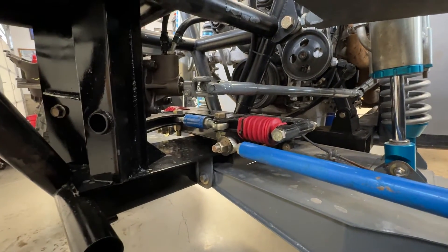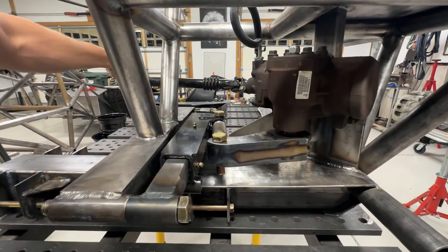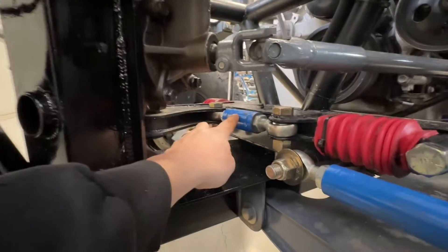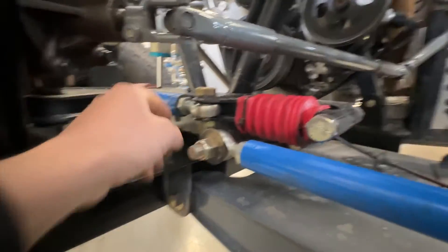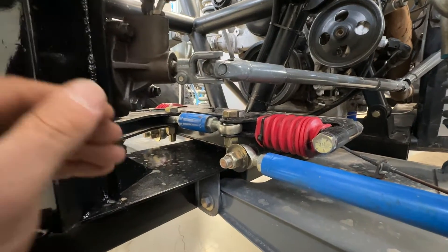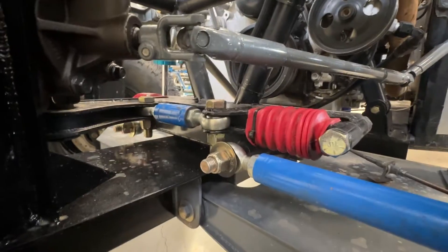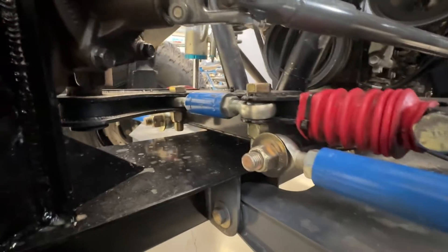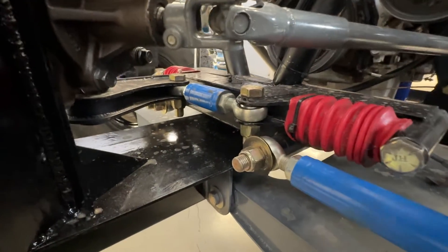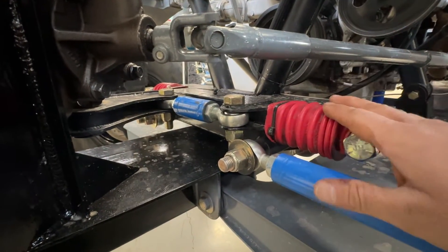Let me start with the good points first — I have videos that show you exactly how I built this thing. This is called the slider. The benefit of the slider is it allows me to use the old stock Silverado 2500 HD steering box. I make my own Pittman arm and through a tie rod I connect to this slider, which goes back and forth and hooks up both of my tie rods out to the spindles. That allows me to maintain the exact geometries I want so that I can have a long travel suspension and minimize the bump steer. This slider was bulletproof — it transmitted massive amounts of load from the tires all the way through. I will call this thing a total win. If you're making one of these, I would make it the same way I did, because the way I mounted it is really easy to maintain — I can get it off, grease it, change the boots if I have to. Total win.